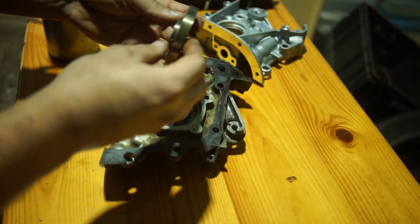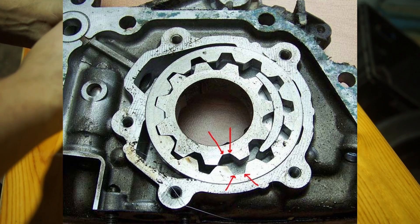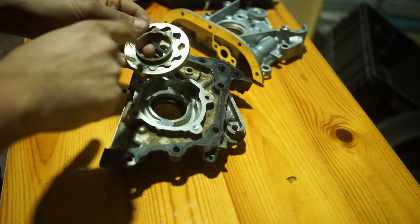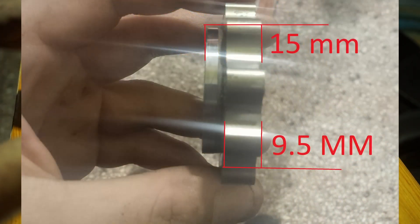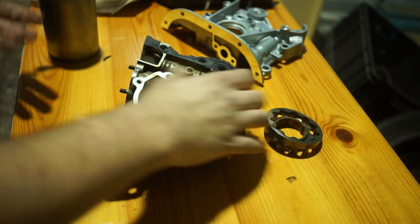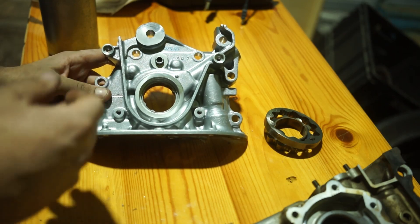On a 4AG, for example, it is most important that you get an oil pump with the thicker gears. There are three different variants. One has a different shape with more edges and is most prone to cracking. Then there's another design with the same shape as this one. And then there's this design, used in the 20-valve engines, which is a bit thicker and has the newer design — that's the one you want, because you can rev to 8,500 or 9,000 RPM with it without major issues. Most aftermarket oil pumps, like this one from Aisin, which is basically the OEM manufacturer, are going to have these bigger gears.